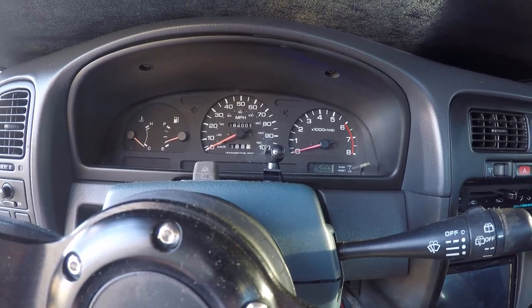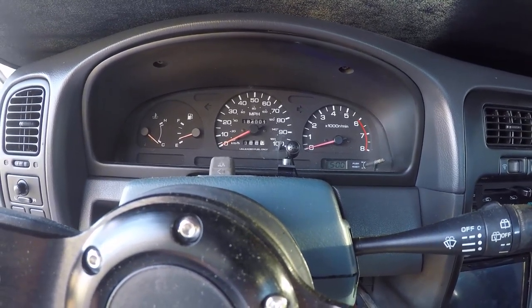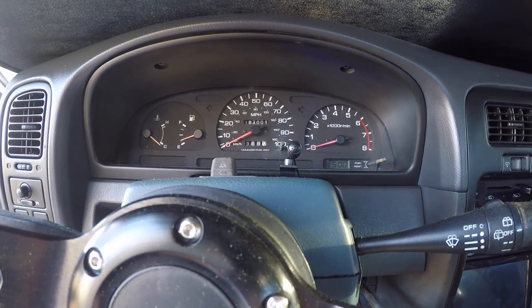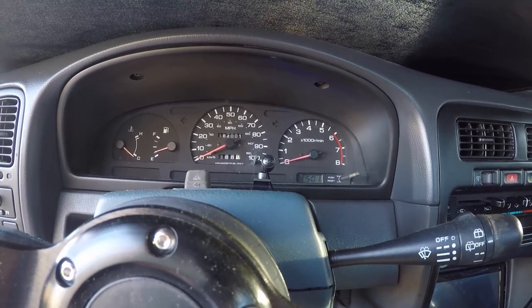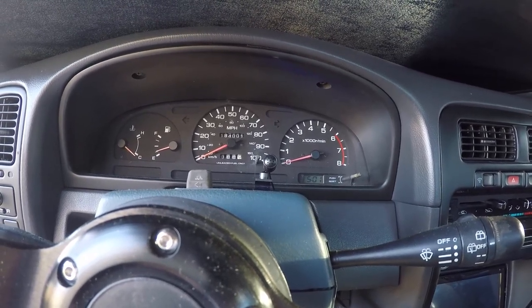This here is the problem — went from a cable-driven speedometer to an electrical speedometer and it stopped working one day. The tach is also improperly adjusted. The instrument cluster came out of a V6 Pathfinder, and there's a little adjustment knob to basically make it work for a four-cylinder. Pretty sure it's improperly adjusted because it reads a little high, so we definitely turned that knob a little too far.